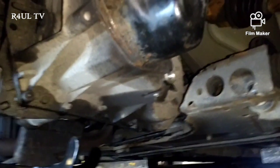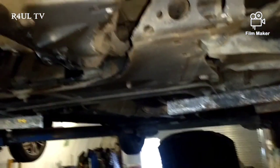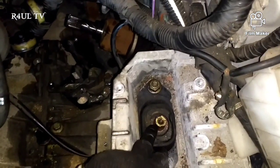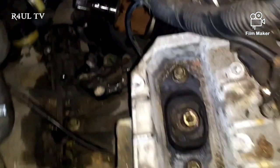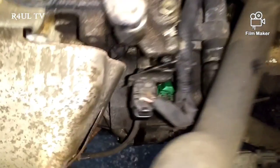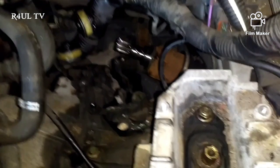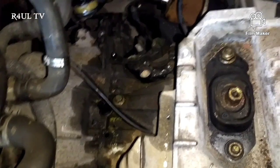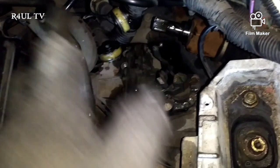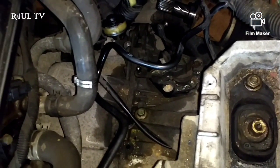The gearbox is back in - with some help from my brother Phil. It was dead easy, went in easier than coming off actually. It was lined up perfectly and went straight in. I've put the engine support mounting brackets on - the engine is stable now. The center stabilizer mount is on as well. I've put the crank angle sensor back on first so I don't drop anything through the hole and have to take the gearbox back off. The first important thing you should do now - before fitting drive shafts, ball joints, bell housing bolts - is put the hydraulic pipe back on for the slave cylinder and bleed the clutch. See if it bleeds up alright and if the clutch pedal feels okay, then start building everything up.